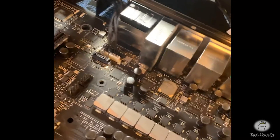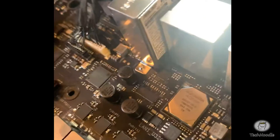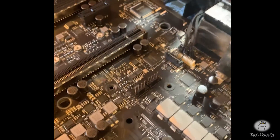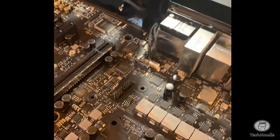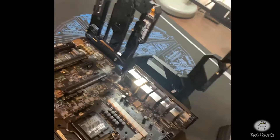If you want to put this completely aside, you could unplug those cables, but do that very carefully because those are a very delicate kind of plug. Certainly do not pull on any of those little wires. You need to use the little plastic lips on those plugs to very carefully prise them up — don't slip and pull out a wire. I prefer to just keep it out of the way; there is just enough length on those cables to tilt it up and get it out of your way.